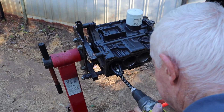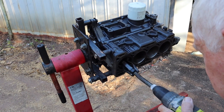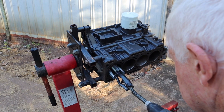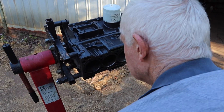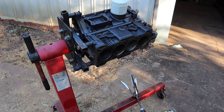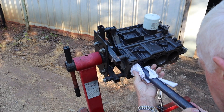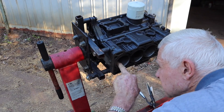All right, there we go again. That's actually not looking too bad. Bit of rag away, it's all clean. It's all just a bit rough - just to get a bit of an idea what we're going to end up with. One little place there the hone's not touching - we've still got a bit of a mark in the bore there.